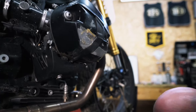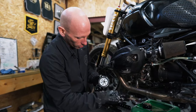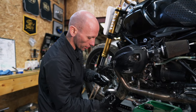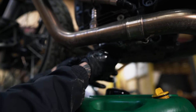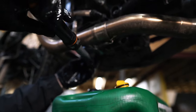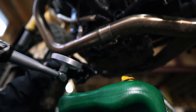That's part one done. Fresh filter — this one's got the ring in it, just make sure the old ring has fallen off so it won't seat improperly. A little tip: take a bit of the used oil from the drip tray and just coat that across the new filter seal to allow it to seal nicely. Stick on your filter tool — there's one big thread right in the middle, you can't get it wrong. Again, fit it by hand first. You do not want anything in the engine to cross-thread. Torque that to 11 Newton meters.